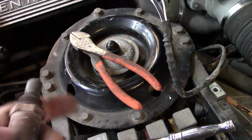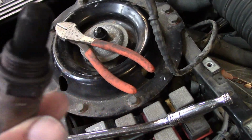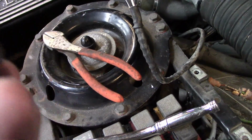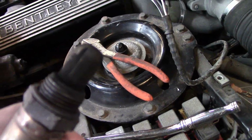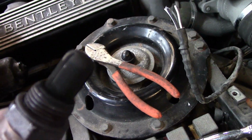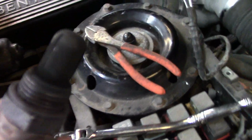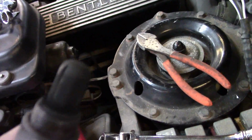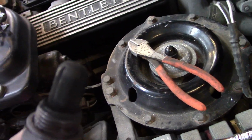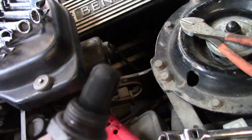I don't know. Alright guys, I can't say anything other than I'm grasping at straws right now, but on the other side, this is the old O2 sensor, and it's basically caked in black. It seems like it was functioning normally until it just went full rich. I'm not sure if the O2 sensor is the problem, or if some other sensor is causing it to run full rich and the O2 sensor is just reporting it. What it would do is bounce between 0.4 and 0.5 volts until it just flips over to 1.27, probably when it goes into closed loop.